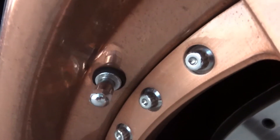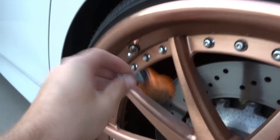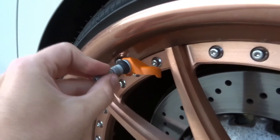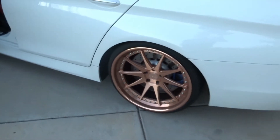On the rears you can see there is absolutely no issue — total clearance all around — just because of the nature of the thin tire. These TPMS sensors are a pain to deal with anyway because they sit right in the drop center of the wheel, which in a design like this doesn't have a very big drop center to begin with, like a lot of cast wheels do.